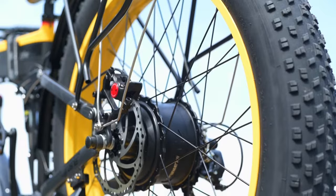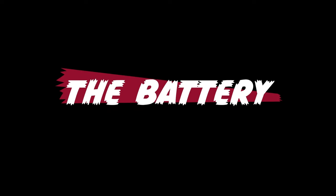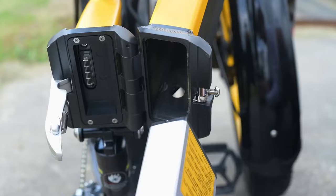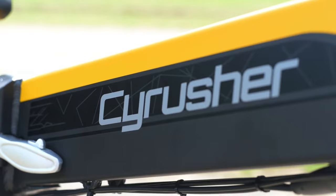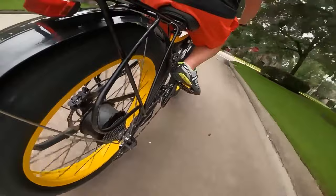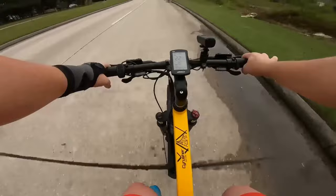Next, let's talk about the battery. The battery in here is a 48-volt, 12.8-amp-hour, 615-watt-hour battery that installs into the down tube, weighing just over 7 pounds — 7.04 pounds to be exact. Once fully charged, which takes about 4 to 6 hours, you can get an estimated 25 to 50 miles, and based on my riding experience that's pretty reasonable. The watt-hours are a little on the lower side — some bikes come with 16 or 17-amp-hour batteries — so it's a bit under average in my opinion.